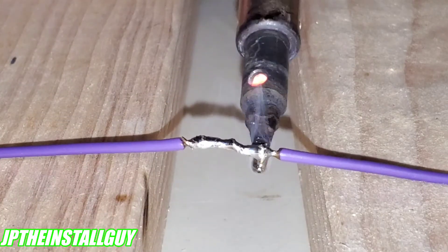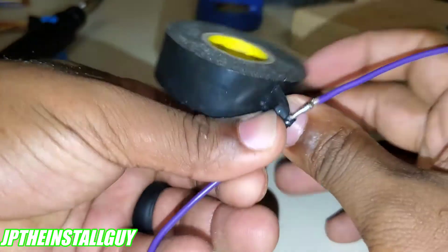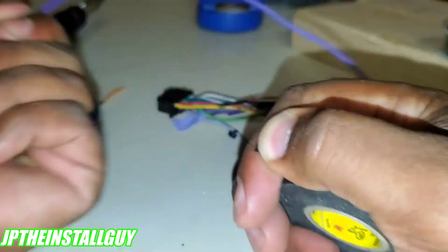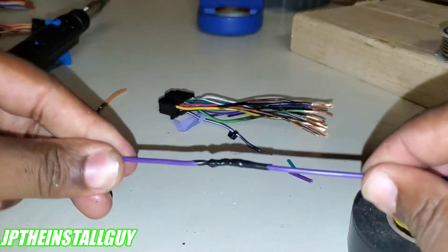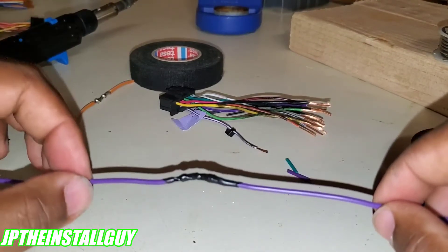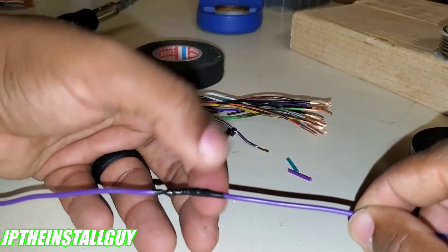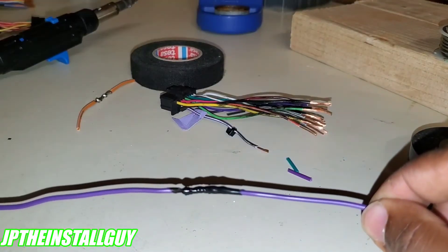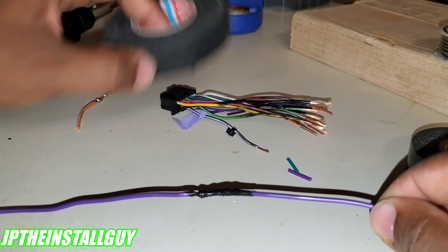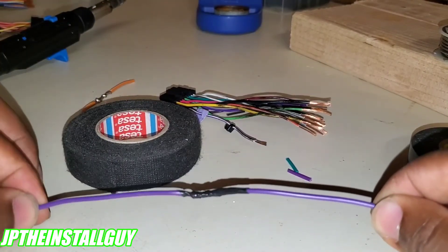If you're just going to tape this up, take your electrical tape, start on one end, and pull and flip to get the tightest wrap possible, then rip it off and twist it together — nice, skinny, and tight. That's a good enough cleanup with just electrical tape. The downside is that when it gets really hot outside, the electrical tape tends to unravel and slide down, leaving your wire exposed. If you use electrical tape, I'd suggest zip-tying the whole harness together, or going a step further with some Tesa tape and rewrapping the whole harness for extra protection.